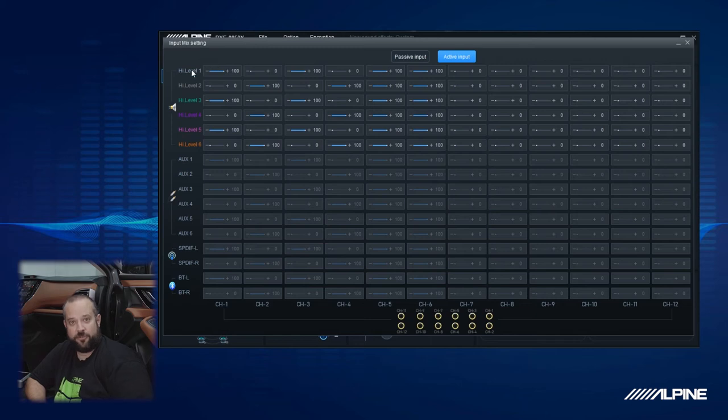So we're going to walk through this. Channel 1 on the output is also going to be our front left tweeter, and we want to make sure we have at least all the frequencies for the tweeter. If we remember before, we actually had about 400 hertz and up on the factory channel. That means that's everything we would ever need to play a tweeter. So we can go through here and zero out the other inputs, because we don't need bass playing through a tweeter. And so I made that one. Here we go. Perfect. So we're good there.